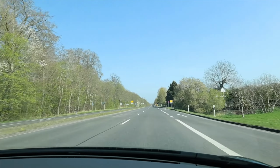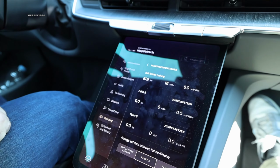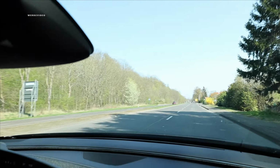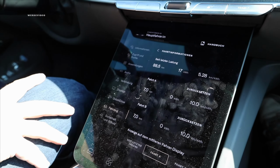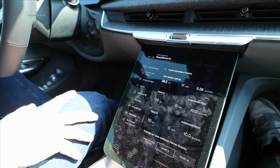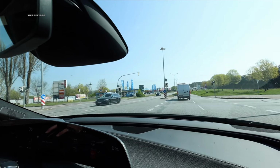We've arrived in Neubrandenburg. You can see it on the town entrance sign, and we'll reset Drive A and Drive B here to get ready for the next approximate distance ahead. 7 kilometers to determine the consumption of the Lucid Air Pure. We've now successfully obtained the first consumption measurement, marking our initial data point. We've passed through Neubrandenburg. You can see it here, 7 kilometers, and we're getting 10 kilometers per kilowatt hour. It's very simple to calculate. 100 divided by 10 equals 10, because 10 times 10 is 100. So we've essentially used 10 kilowatt hours per 100 kilometers driven here through Neubrandenburg.